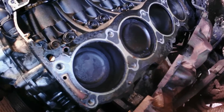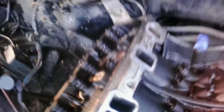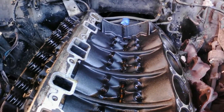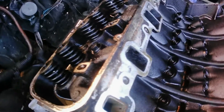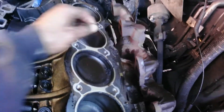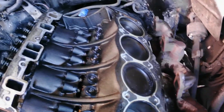I don't see any milky oil so that's a good sign. I knew I didn't get any freeze crack on the heads — it's only a leak back on that corner right there, so that's the reason I'm doing this. It is dirty though. Hopefully I can clean it decent because I gotta get it done. I don't think I need it done today but I would love to. Look at all that right there — it's pretty bad. The sleeves look fine though; gotta clean it a little bit.